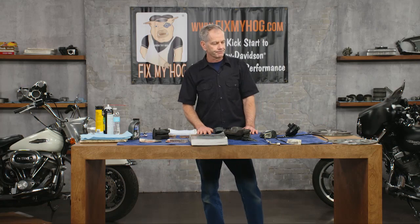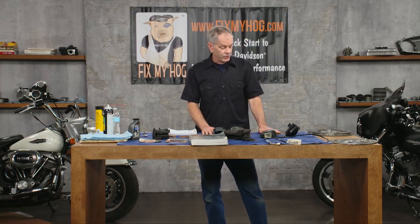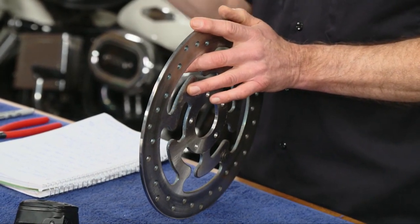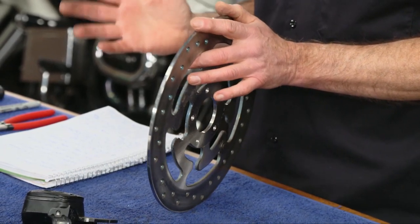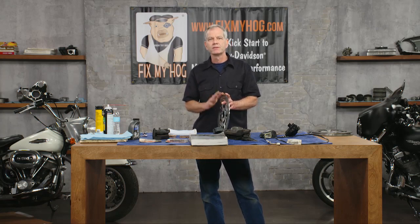Back in 1990, a buddy of mine was road racing at Road America doing a three-hour race when the factory Yamaha team came in for testing. Jamie James got off his bike, they put it up on lifts, spun the front wheel, and it rotated for like five minutes — zero resistance. It's a race bike; the brakes retract completely so the wheel can freewheel because they want to go fast but also stop. When working on your motorcycle, after you put brake pads in and set the brake level, have the wheel off the ground and determine: is this thing freewheeling properly? Because it's your brakes, and it's not a car — when you fall on asphalt, it hurts.